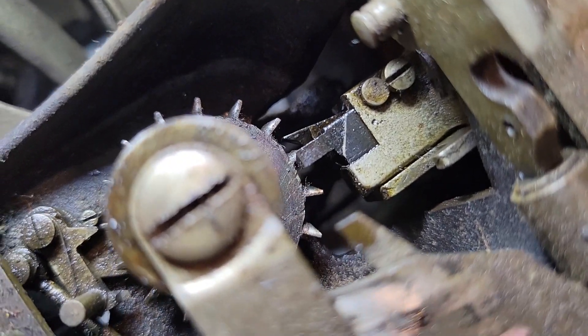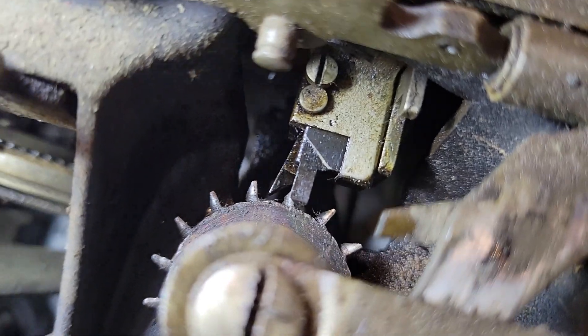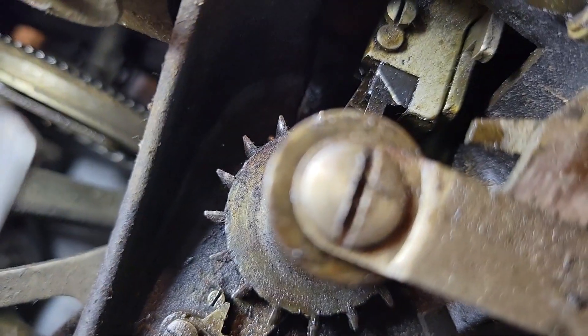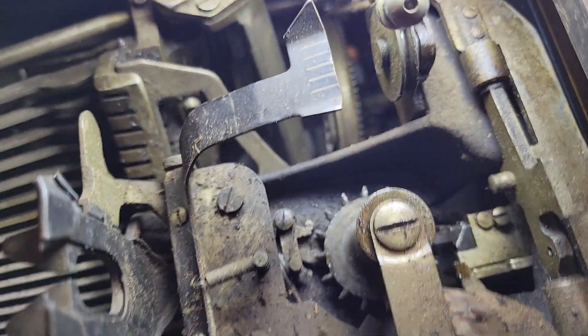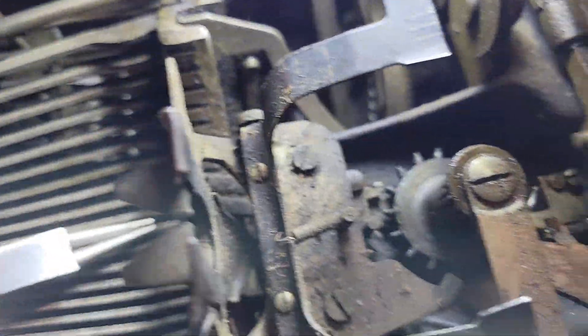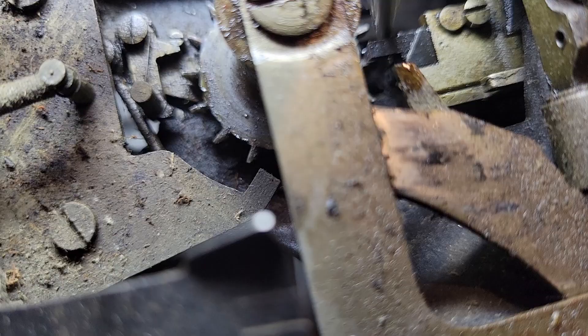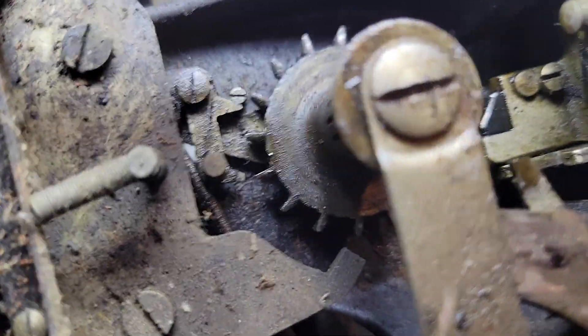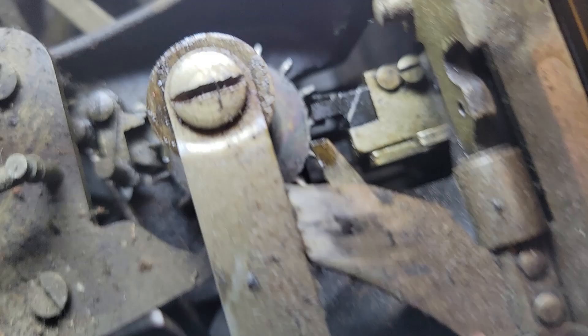I did have to do a few reheatings to get it aligned. Now I'm extremely hopeful. It was quite dismaying, but now I can see that this does seem to be a pretty viable method for repairing an escapement. I might be a bit concerned for the amount of heat introduced into this area, but the floating dog is still working. Probably one obvious advantage of soldering compared to brazing — the only difference being the amount of heat used — is that soldering is probably under any temperature at which the metallurgical properties of the parts would change. So after cooling it should just go back to normal.